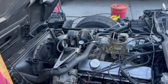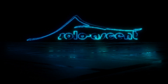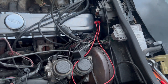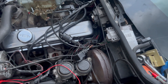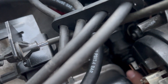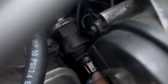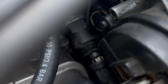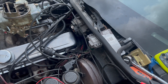Issue resolved! Currently, I have done a litany of things. I have taken off the oil pressure sensor — right down here. Normally, oil pressure sensors have one prong, but this one has three. The middle prong is for oil pressure, and the side two are a switch that connects the fuel pump. So if there's no pressure, the fuel pump will shut off. I've tested that and I bypassed the oil pressure sensor.